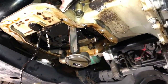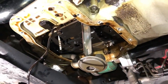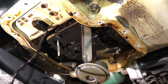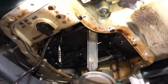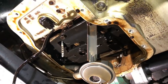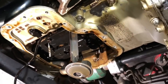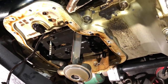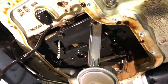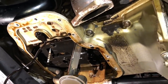I've just taken the exhaust off and the lower part of the sump. I wanted to show how to do an LEH delete — removing the balancer shafts that come on the Z20 LET. The Z20 LEH doesn't have them because it has a dual mass flywheel. But this one's already been done, as the engine had been rebuilt at some point. When they've been rebuilt you can't really put the balancer shafts back in because they all need shimming, so a delete kit is the quicker option.